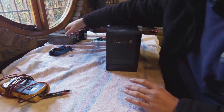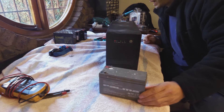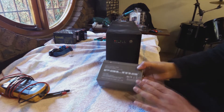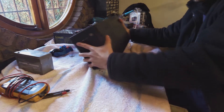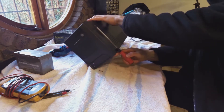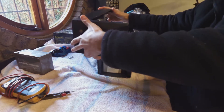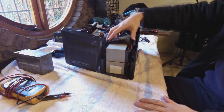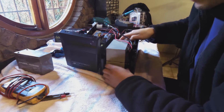I suspect that it's the batteries. Inside these small UPSs are 7Ah batteries. This UPS happens to be a 1200 watt or 2000 VA UPS. It's got these batteries in and I suspect the battery is faulty. I firstly unplugged it, took the kettle plug out. There are several screws here — you'll need a really long screwdriver. Now I've unscrewed the cover and I can see the two batteries. I want to take them out and test them.